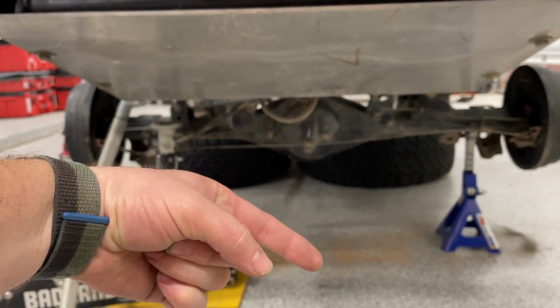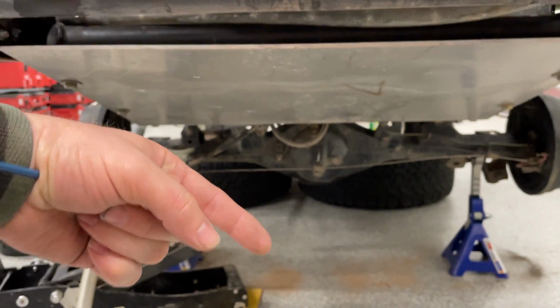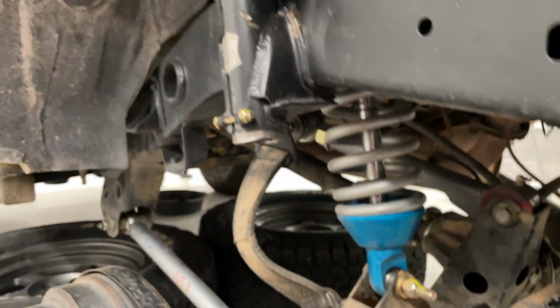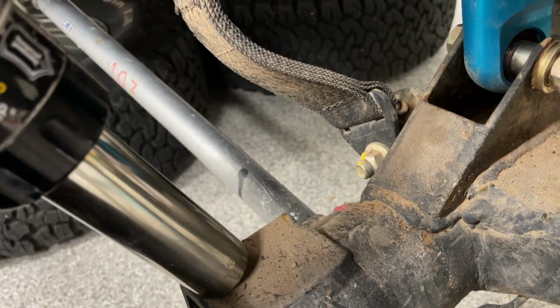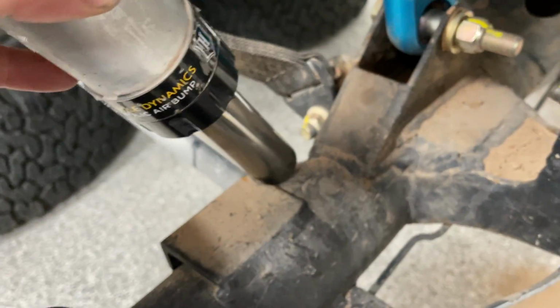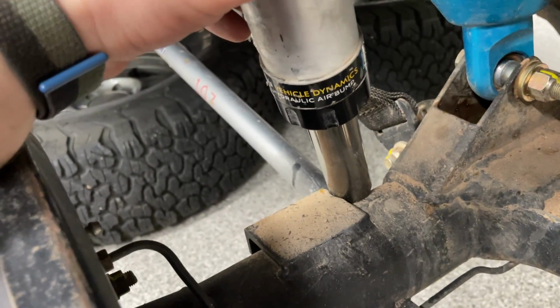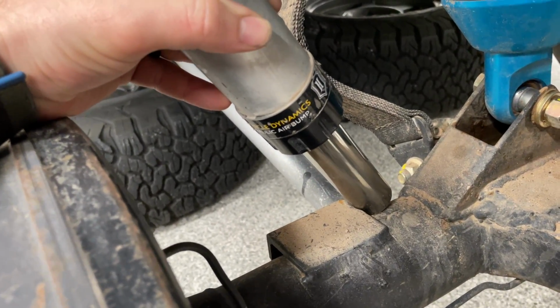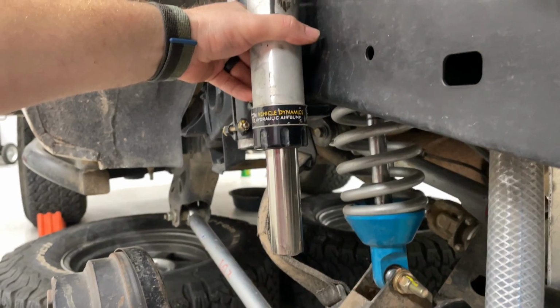If the whole axle is flexed out hard down and hard up, well, imagine this axle, now that it is not aligned with the bump stop. See this cut right here? This little U hole? That matches the radius pretty darn well. So if this is caught, okay? If this is caught by the suspension now that it's moved, and now the suspension is pulling it inwards, now it'll take the frame and do this to it.